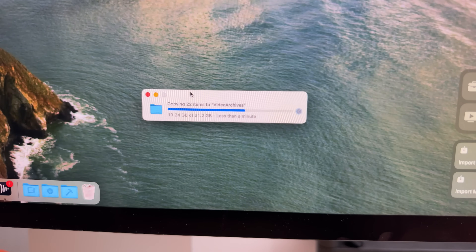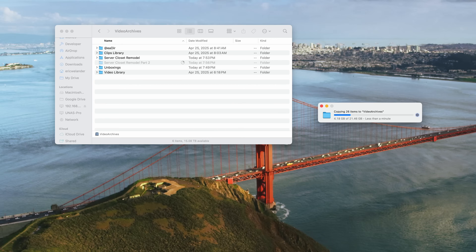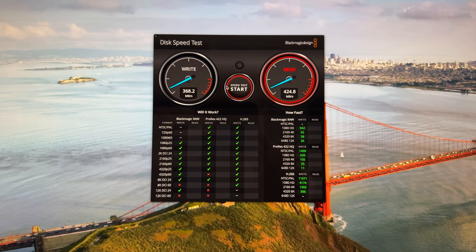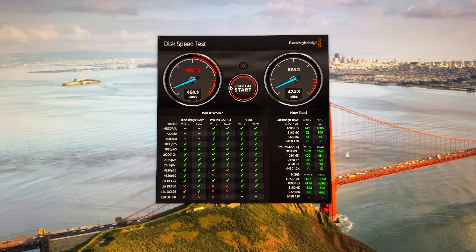What about faster wired networking? If you have a lot of things you like to access on your local network — especially bandwidth-intensive stuff — having 10-gigabit-per-second Ethernet is just amazing. The file transfer and interaction speed is so fast. But if you don't have that, regular gigabit Ethernet is plenty fast for most use cases, and gaming isn't really going to see a latency decrease from faster Ethernet speeds unless you move to a different cable technology like SFP+. Of course, if your internet connection is faster than 1,000 Mbps, faster Ethernet will give you access to all that speed.